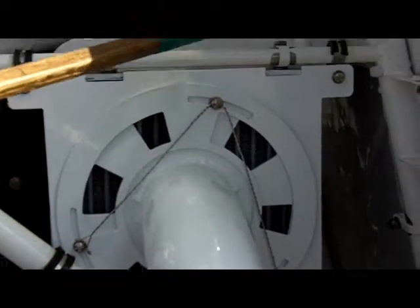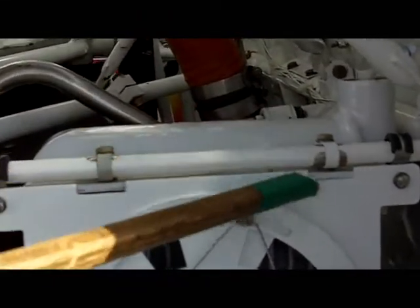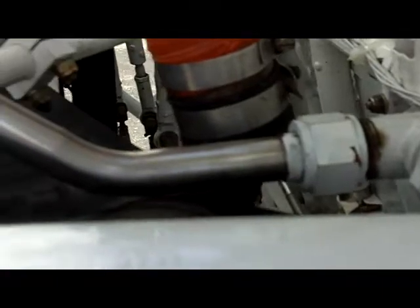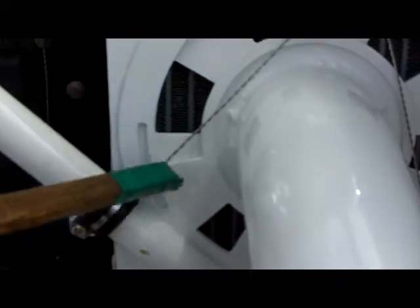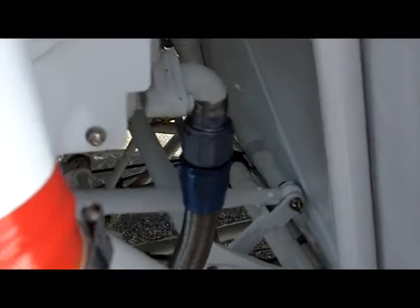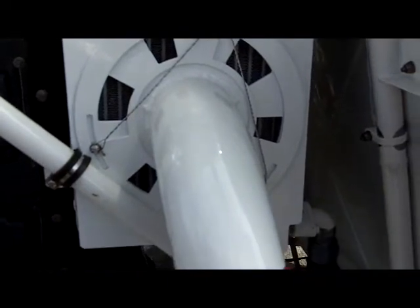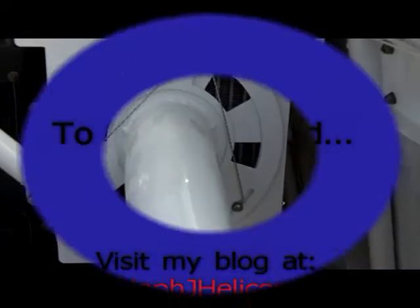Here's a picture of the same oil cooler but this time with a heat shroud on it. That takes hot air off the oil cooler and brings it into the cockpit for defrosting and heating — unusual, since most systems come off the exhaust manifold. We preflight it the same way: check for leaks, security, cracks, make sure the shroud is secure, clean, no damage to the vents, and check the flexible hose that goes down into the cockpit.